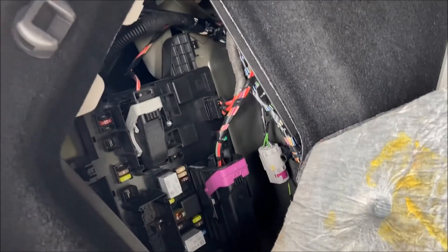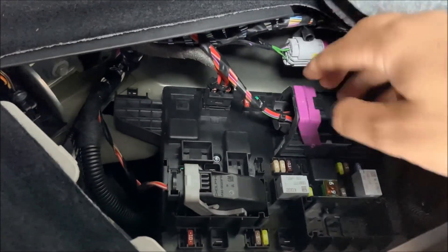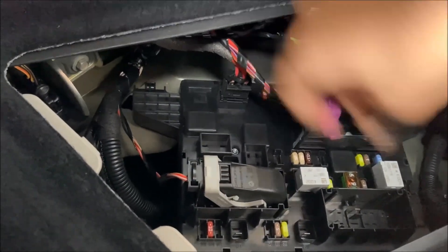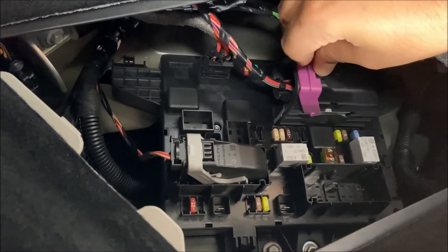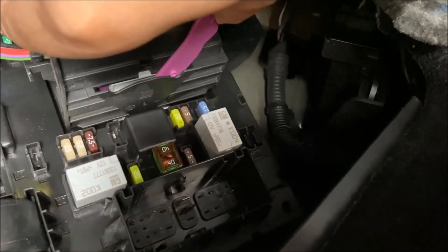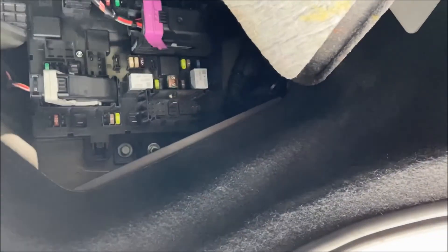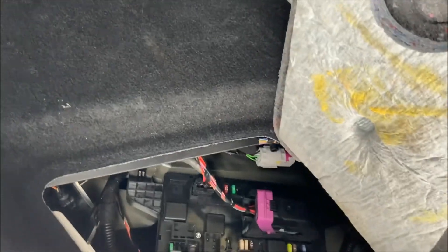In terms of the REC module, the pin we'll be attaching one of the wires to is in this big connector here. The pin you need to make sure you have is pin 33, just down here. This vehicle has that pin from factory and some vehicles may not, so you will need to check. If your vehicle requires that pin and it doesn't have it, it's just a matter of wiring it in and putting the relevant connector in place.